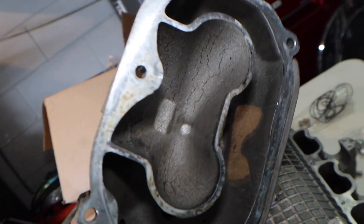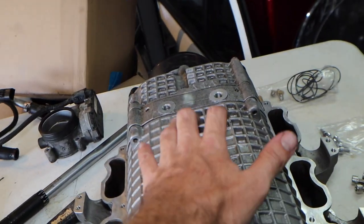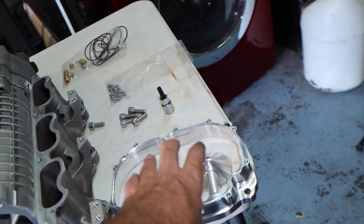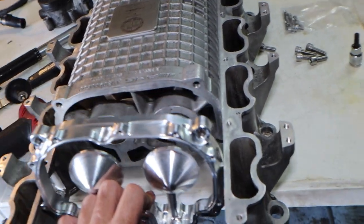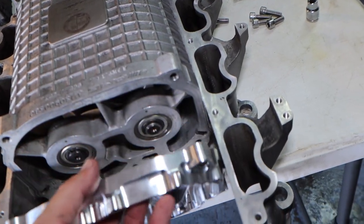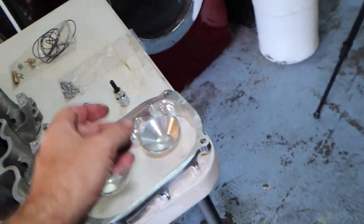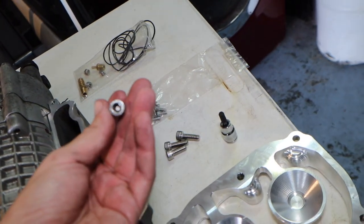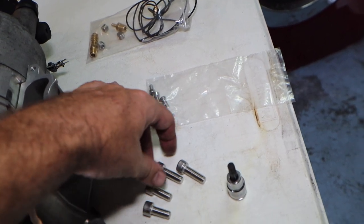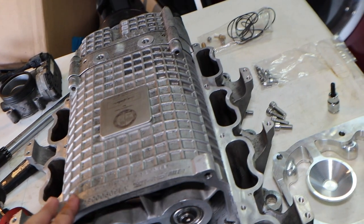I tested fitting the front half of the snout without the intercooler on, but I'll never be able to get the top bolts to tighten up that way, so we're going to pull the intercooler off. It was a little wet anyway and I need to let it dry. We're going to leave these bolts a little loose and work on the gasket. I'll get the RTV out. Just look at how much more flow you get with this ported snout — it actually covers the bearings underneath and looks really good.